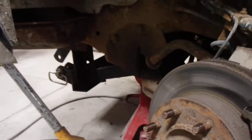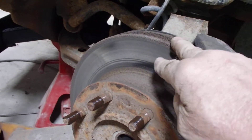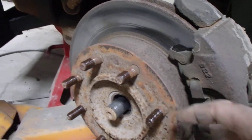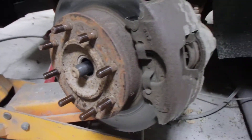Then we'll set aside the caliper and push that caliper back with the tool. After we get that done, we'll go to taking off the rotor. You think like everything else the rotor just comes off - nope. This ring right here is actually part of another inner part. This is the rotor all the way up to here, so we gotta knock these guys out later. They're from the back of the rotor through here and the splines all hit there.